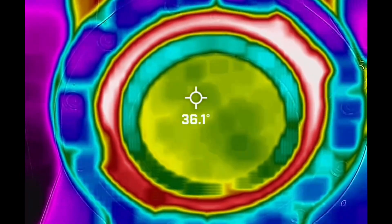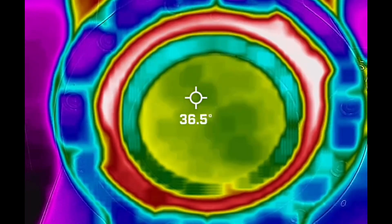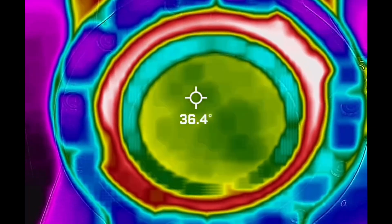I reoriented the camera here and I want to flush the shower screen to see how it does. This shower screen is the Matrix Nano, which has a modification to make the water come more from the center than anywhere else. This test showed that the water was coming through, but it wasn't getting up to the temperature I wanted — it maxed out at like 81, 82°C.